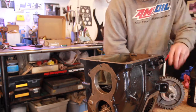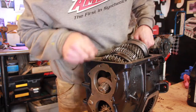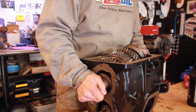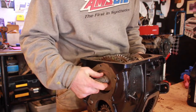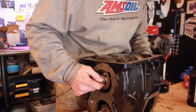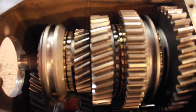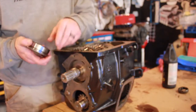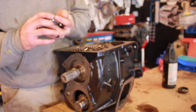Anyway, good clean case, freshly painted. Now grab your main shaft. I think probably dropping the rear end first would be the way to go. Keep an eye on all your stuff — that thrust washer is floating around a little bit. Keep your fingers out of the way.